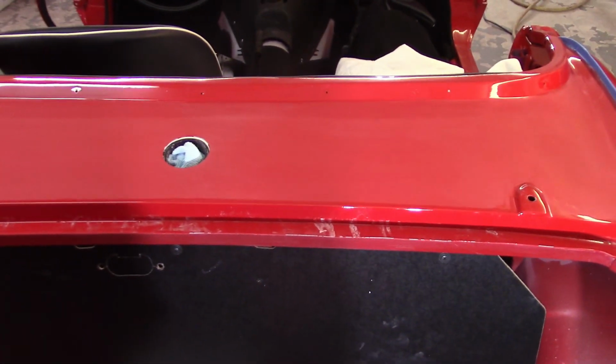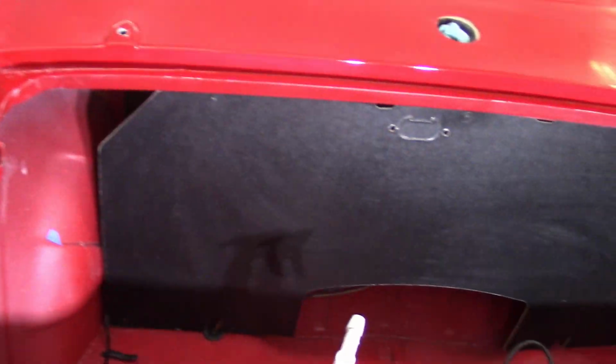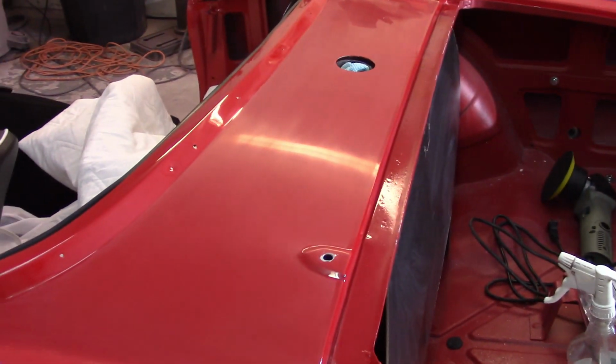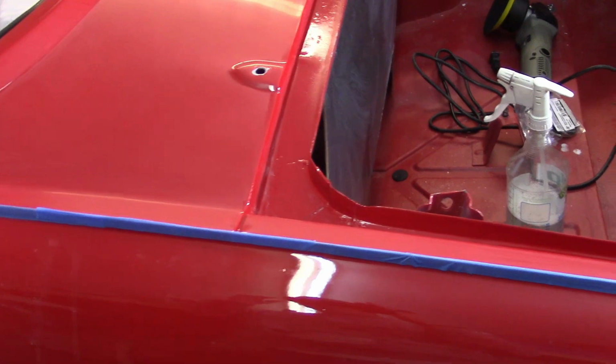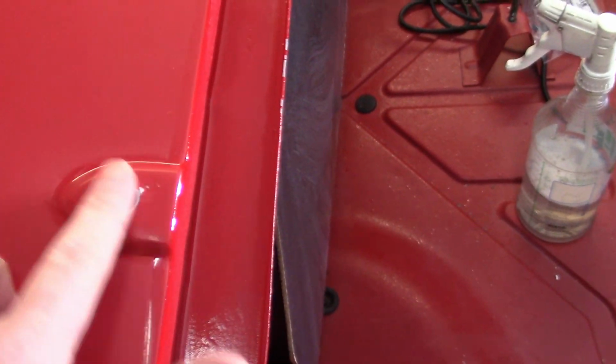So I'll grab a bite to eat real quick and then I'll come back and do the 3000 on this stuff. Looking good through 3000. Time to step up to the buffing wheel now. You can see it's got a pretty good sheen in there, so I'm happy with the way that it looks. I think it's gonna buff out just fine. I did do the 3000 a little bit on the hinge cover and you can see that it dulled it up just a little bit. But I expect that to pop right back